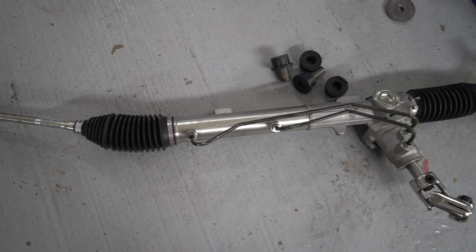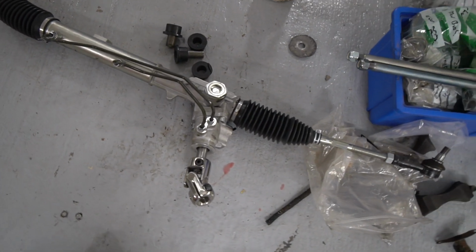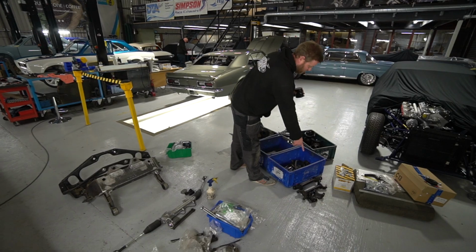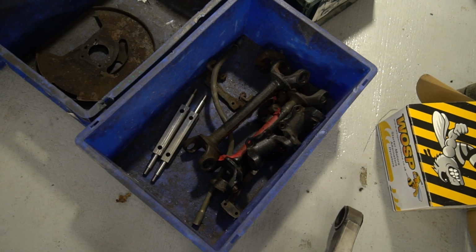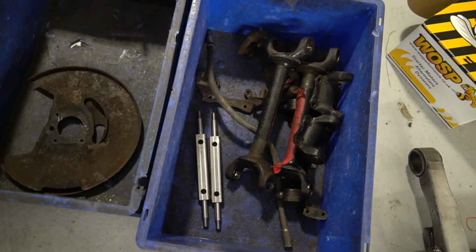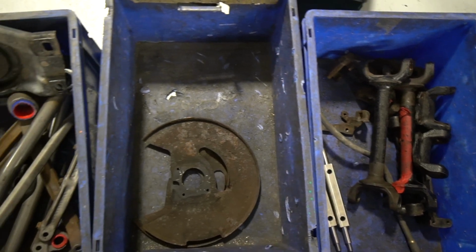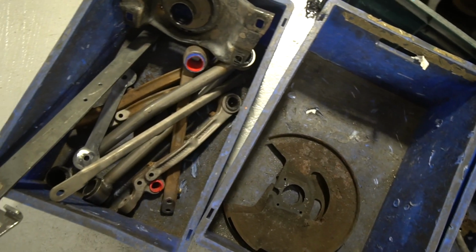And then all of the peripheral components of that have now been disassembled into all their individual parts, and the same with the rear end. So these are the drive shafts, for example, with the UJs disassembled, so the bearings are out of those, and we're down to just the core components, ready to go for blasting, zinc metal spraying and powder coating. And the same applies to everything. So everything's in individual parts, but also then masked.